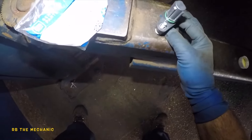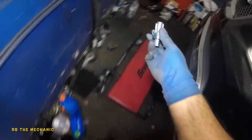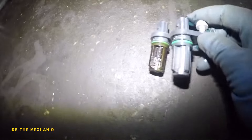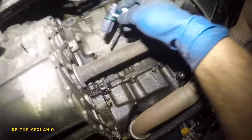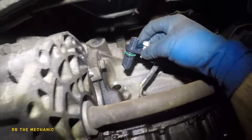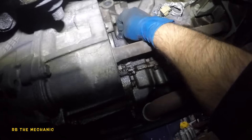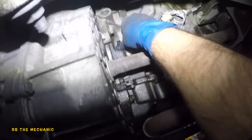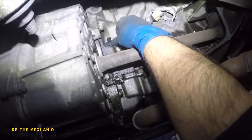Let me show you guys the numbers right there again. So here's the sensor I got under the package. What I like to do to the sensor is use a synthetic oil — it doesn't matter, any motor oil. Just take a dab of it and put it all around the seal. All you want to do is lubricate that seal. And now we're going to go underneath. You want to take the old sensor and match it up — it should be the same length. It can't go any further than that. If it's longer, no good — it's probably going to hit inside and might be the wrong sensor. Here's our new crank sensor. You should feel a click in there as it goes in. You should be able to push this guy in, but don't depend on this bolt. Try to manage to get the sensor in there flush, and once it's flush, then you can tighten it up.